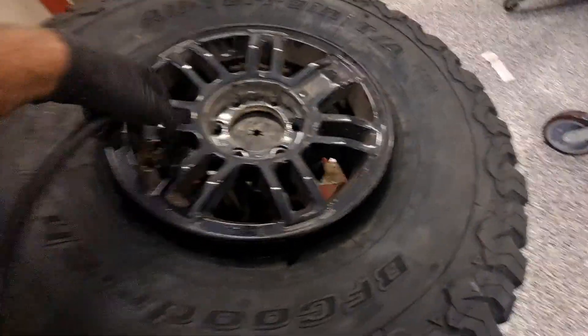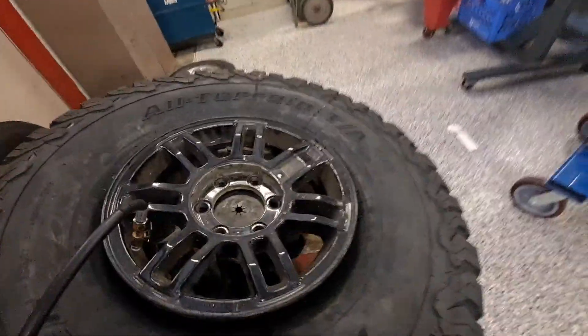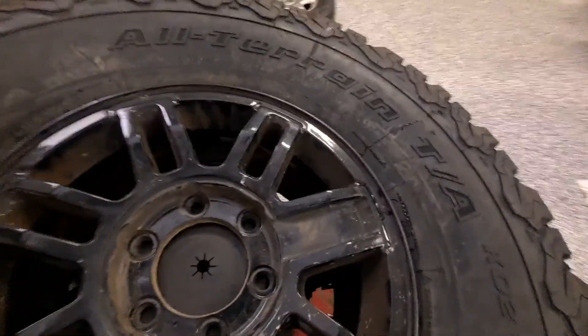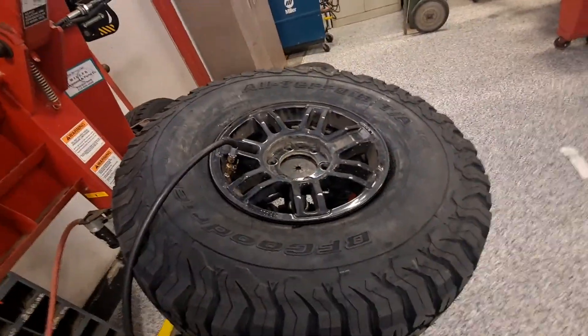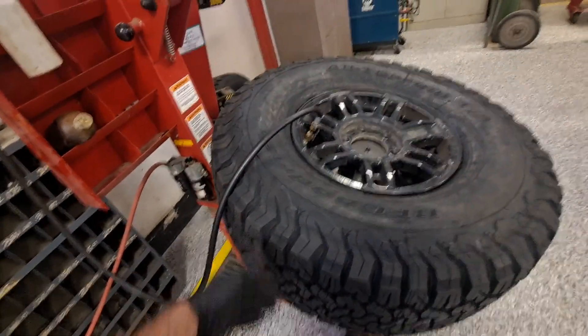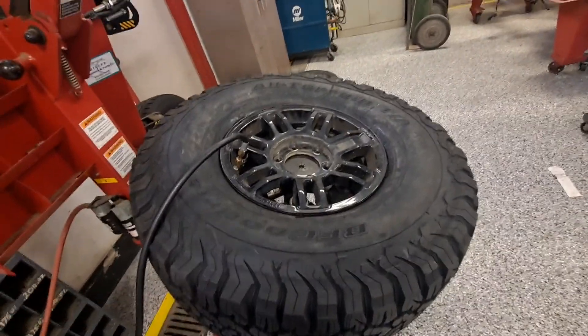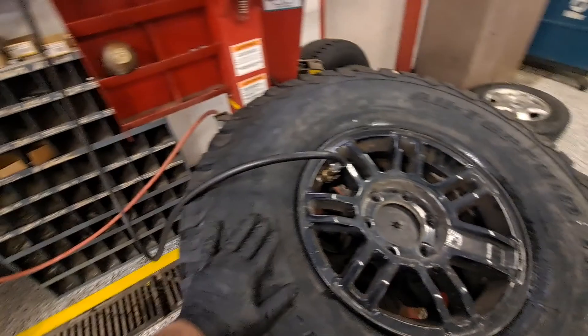It's not really the point of this video, but as always when you're doing this kind of work, be careful with that TPMS sensor — don't break it because you're in a rush or frustrated about doing the job twice. It's well worth it. I drive this truck as my own, and I would pay the extra money for road force mounting. I got 50,000 miles out of the last set — I don't want to deal with a vibration for the next 50K. I recommend road force mounts on every tire, though it takes more time and I'd charge accordingly.